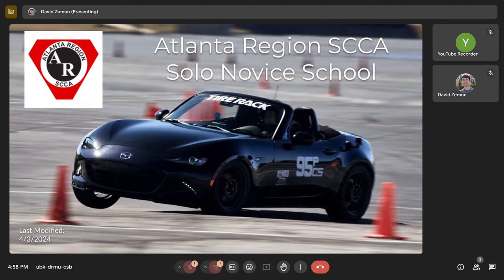At your first event, air up your tires. Don't air them down. If you've already got some racing experience, you've got 200 treadwear tires, whatever, you probably already know how to start for your tires. But if you just have a normal street car, air up your tires to 40, 45, maybe. That's probably high enough. Then you can work down based on chalk lines to see how low you can get them. It depends on your car.